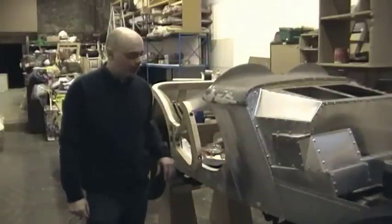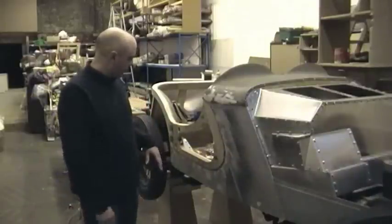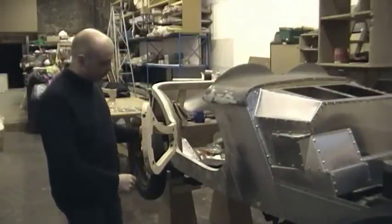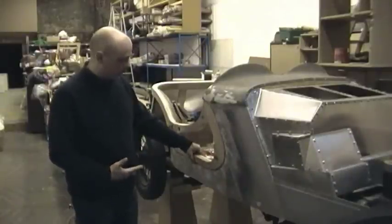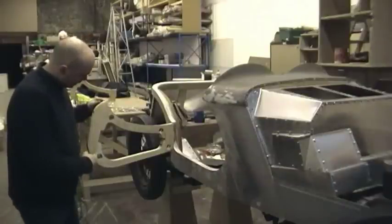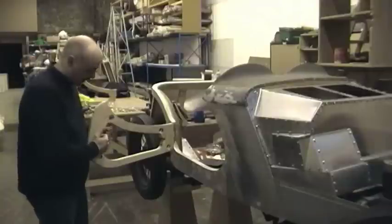I'm going to make a car door for this Austin 7. This is the driver side which is already almost completely made. You can see that it's got a twist going all the way down, which is what makes it much more complicated to make because it's not a flat section. It's bolted together and done in such a way — butt jointed — so that the bits can be twisted and then finally bolted and doweled in position.